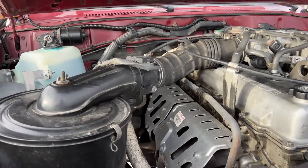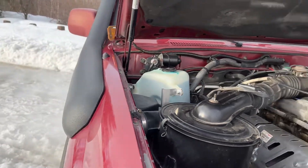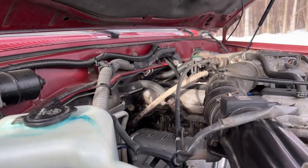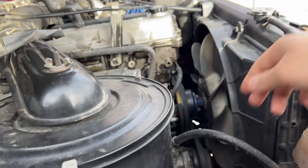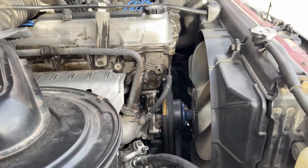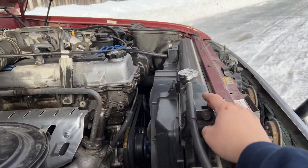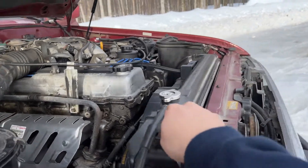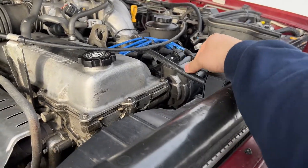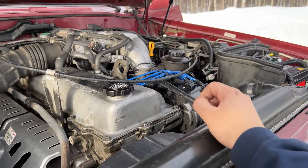Overall I'm really happy with this vehicle — I love it. The only downside is the gas mileage, but if you can get past that it's totally fine. The clutch fan still works fine, spins freely. The water pump might be good but I want to replace it anyway. I might also get a new Denso radiator — the reason is that the nipple on the radiator is broken, so there's not much for the hose to hold onto.